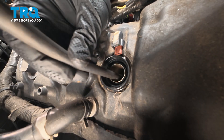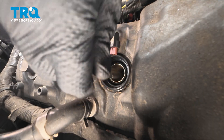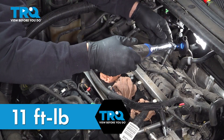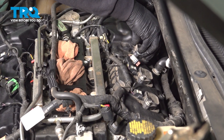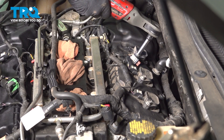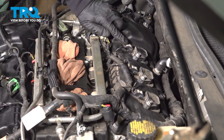Once the plug stops spinning freely, pop that hose right off. Now take a standard 16mm socket — you can push the rubber grommet out of that socket — drop it down inside, and finish snugging that down. Go ahead and torque that spark plug down to 11 foot-pounds. Then go ahead and install the ignition coil, snugging it gently. Press it on and engage your lock.